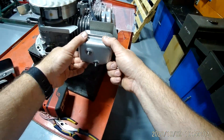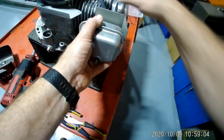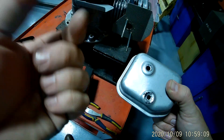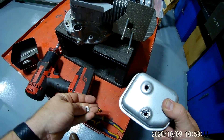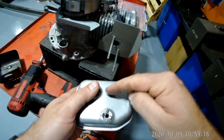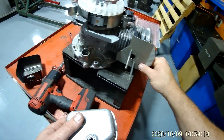Here's my muffler. Now, this muffler has these little — I guess you would call them washers. Don't lose those. These help seal up to make sure exhaust gases don't escape. So if you don't put these back on, exhaust gases are going to escape from here.